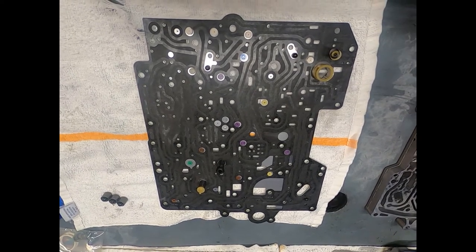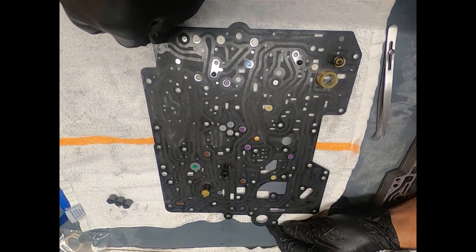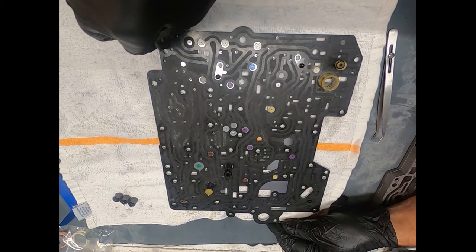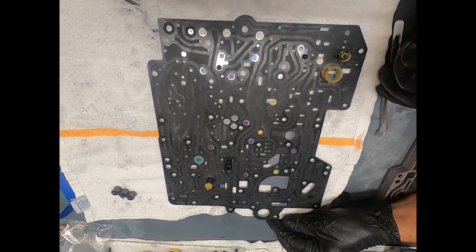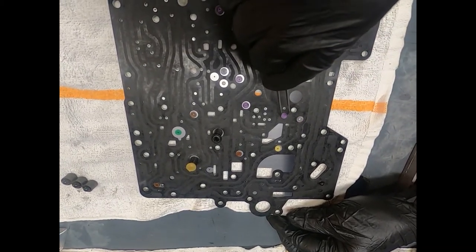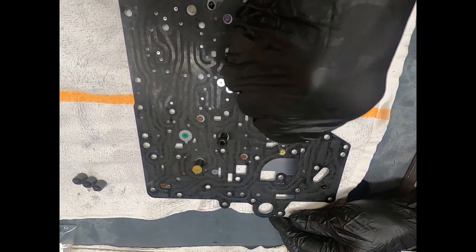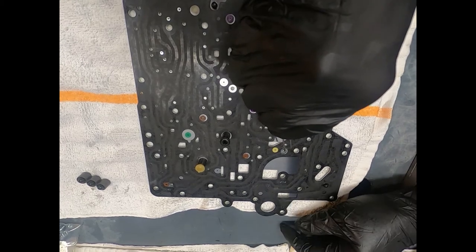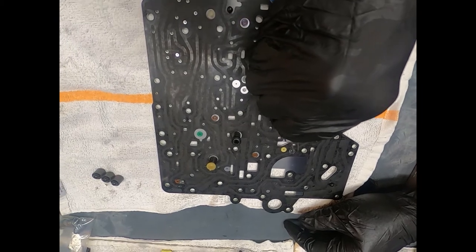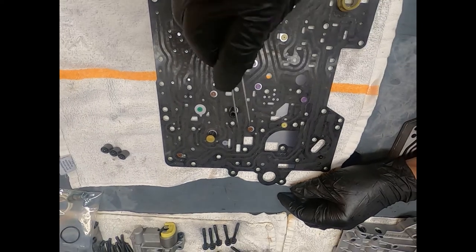Now, I painstakingly have taken pictures of this with my iPhone. As you can see, we're making a video right now, and I do get a new gasket in my kit. And one of the things that I was doing, which can help identify where these actually go. Of course, you want to be careful as you take this apart, as there's a clear witness mark on the plate every place there was a check valve. And you'll see what I mean when I say witness mark. After 16, 17 years of operation, there we see it indeed leaves its signature on the plate.